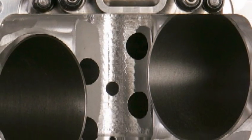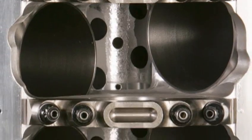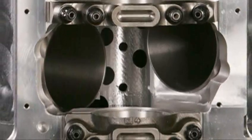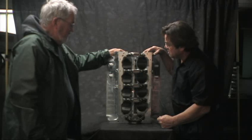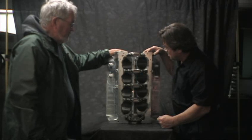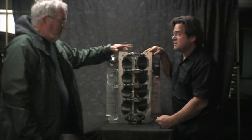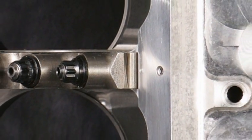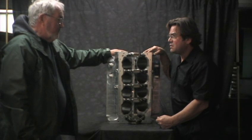All the way from 60 millimeter down to a stock small block size. The prettiest little main caps I've ever seen. Yeah, we got rid of all the excess weight out of them too. They're ductile iron — rigid and strong. The coefficient of expansion in aluminum is a lot greater than iron, so these iron caps hold the main size even when the engine's hot. If you've got an aluminum cap in an aluminum block and it gets really hot, you increase the clearance and start losing oil pressure.